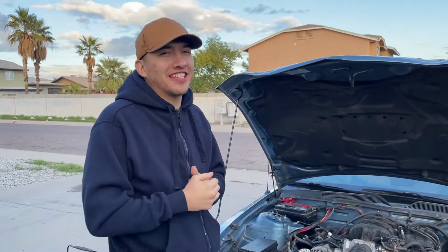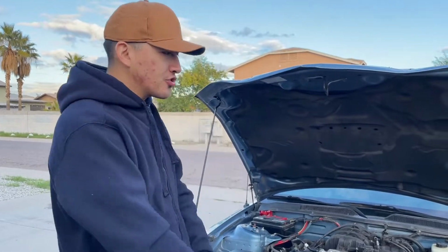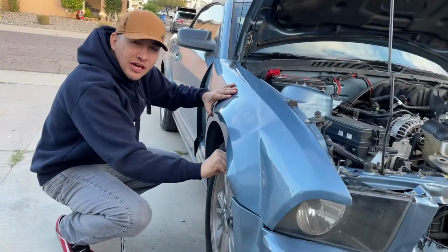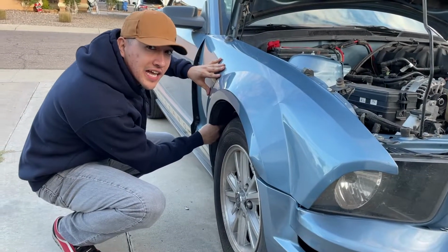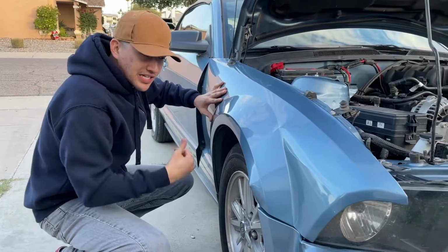And we are back here another day on the Mustang build. And guys, we are gonna start building the whole front side. So we are gonna start off by removing both of the fenders, and we're gonna take off this bumper, guys. But follow me, we have to first take off these wheel wells so we can get to all the bolts that are back here for the bumper and for the fender too, because it has one right over here inside. That's the hardest one to get to if you don't take off these wheel wells. But let's get started, guys.